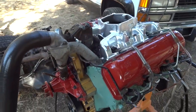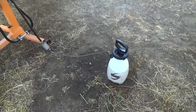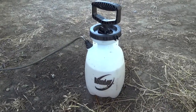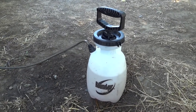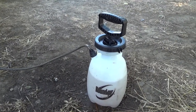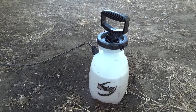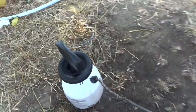So let me tell you a little bit about what's going on here. I hooked up a bottle with diesel in it and I put some Lucas injector cleaner in the bottle. This bottle is acting as the gas tank and the fuel pump — I'm going to pump it up to about 20–25 psi, and that will supply the engine with fuel.